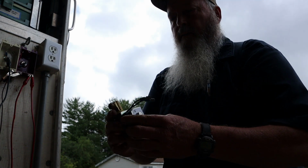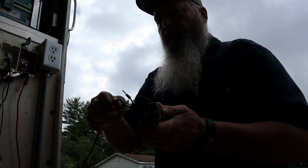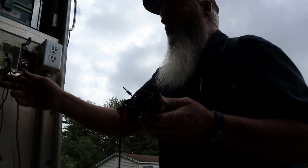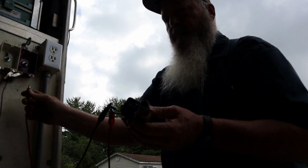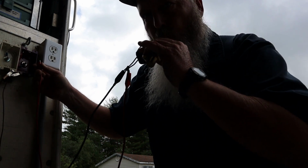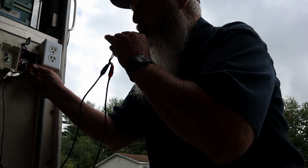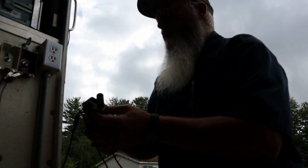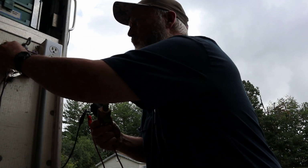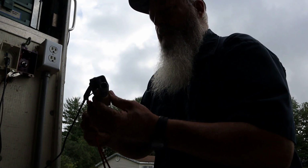So I just went ahead and took the solenoid off, past the regulator, and hooked my 12-volt power and ground up to it again. Click, it opens, right here. I can blow through it. I take the power away and I can't blow through it. So there is nothing wrong with this solenoid at all. It's working perfectly. So now what's going on?